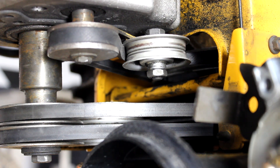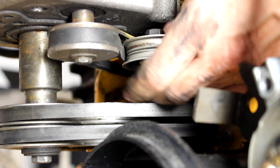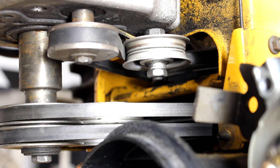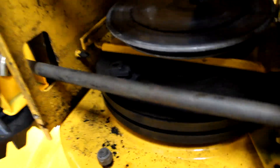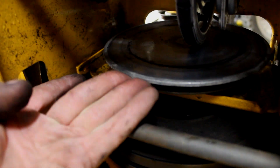The camera battery died and I switched out the batteries, but essentially the new drive belt is in. It's very tight to get in, but basically once you play with the idle wheel and kind of force it up there, it will eventually go. Some people use a screwdriver — I don't really recommend that because you can pierce the belt. A tip: I like to bump this wheel up here. When you raise this plate up a little bit, it gives you a little bit more play. If you remember, we took that bolt out, and with this whole thing tipping up it gives you a tiny bit more play. And just to show you this friction wheel — you can see how beat up it actually is. You can see the crack there, and there are a few more cracks, so we definitely want to replace that.